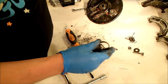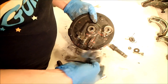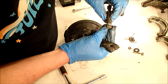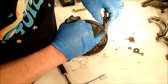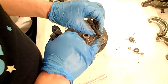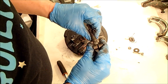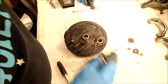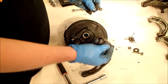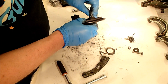I didn't catch it on camera — I accidentally took it off. We had this spring on and it just sort of took wiggling. I was having a good old look at it, gave it a wiggle, and there's a section on here without any splines. I don't know if that will show up on camera, but on here there's an area where there are no splines and they kind of marry up with the split in the back of the fork.